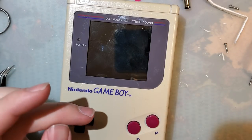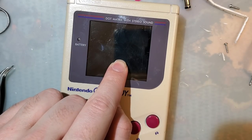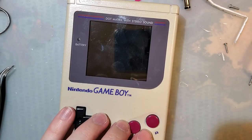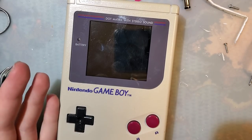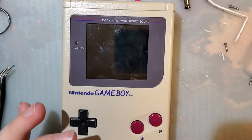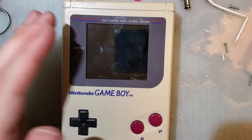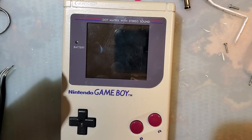In the description, there's going to be a link to a spreadsheet that I am continuously updating with all of my backlight kits, that I measure the brightness of the screen itself and the power consumption difference. Not just the power consumption, we're only looking at the difference because every console is going to be a little bit different in that regard. So with that difference, I can then calculate the projected battery life. So if the original screen used 50 milliamps and this one uses 150, the projected battery life is 30%, something like that. It's easy enough to estimate, to give you real world estimates. So if you used to get 30 hours, now you'll get 10 hours, something like that. Obviously it's never that clean cut, but those are just examples.